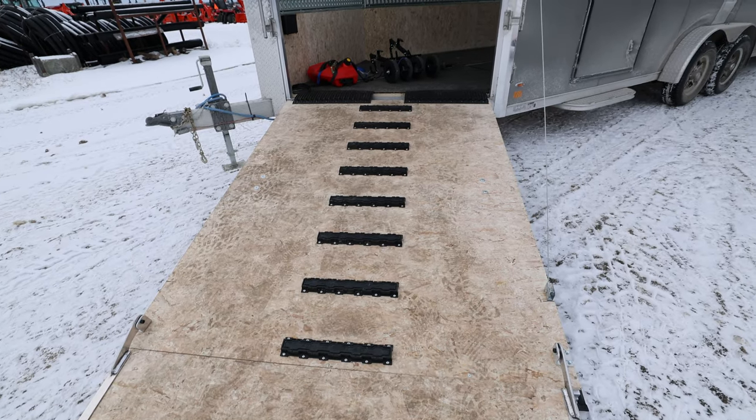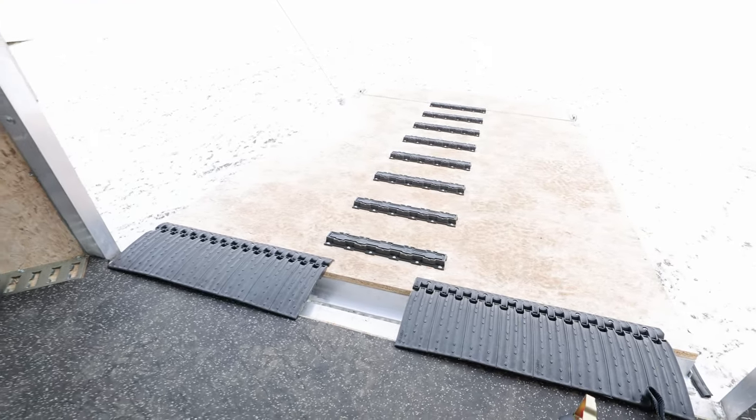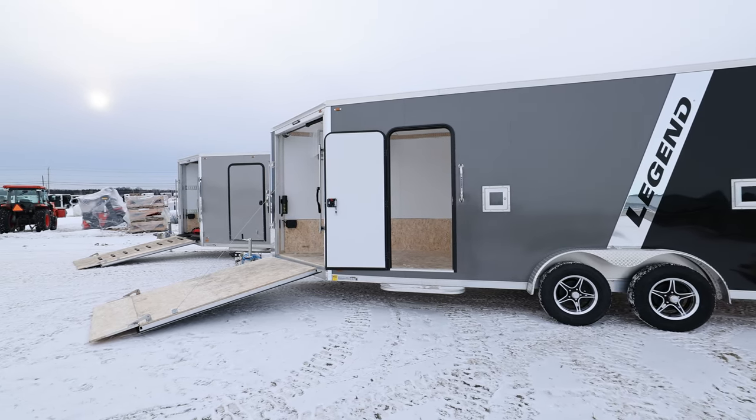We'll look at the front ramp — I've done some track grips, or track guides, to come up that ramp along with some transition flaps to gap the space between the ramp and the floor, which also keeps snow out when you're putting it back up. The last thing you saw in the other trailer was the two-tone color, which is standard with the Explorer series — you can do standard colors or upgraded colors and mix and match front and back. I wanted a solid color because I've got a few different trucks, so I chose to do both colors the same. I also upgraded to a 40-mil panel — the 30-mil panel is your standard thickness, and the 40-mil is just that much thicker and more rigid, which helps when I'm hauling a 4,000-pound tractor, along with the 12-inch centers on the structure.